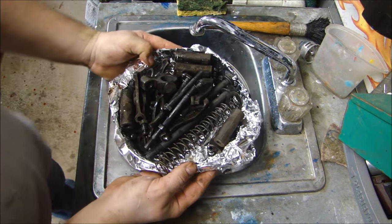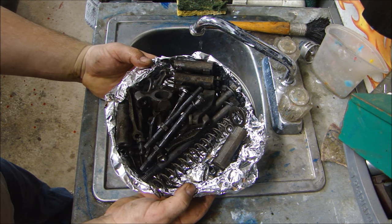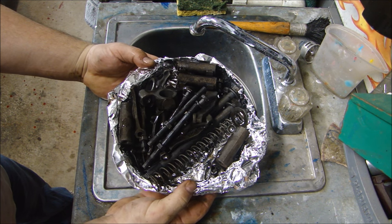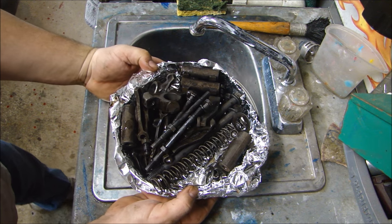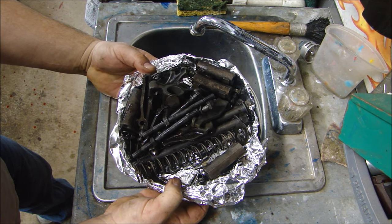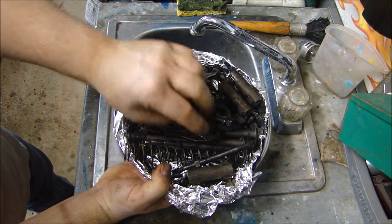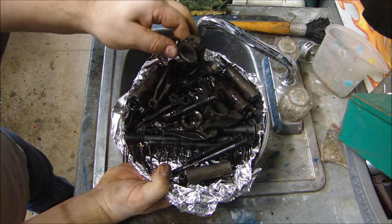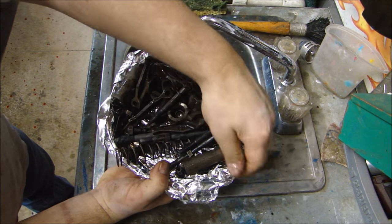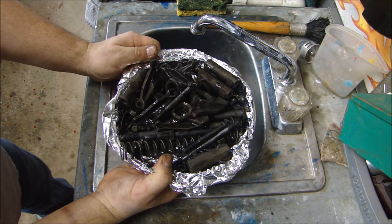Just to make sure I get every last bit, I'm going to put these in an oven and bake them at 375 degrees, leaving them in there for a few hours just to bake off that last amount of oil. Luckily I have an oven in my shop — the same oven I use for powder coating — where I can bake parts. But you can put them in your kitchen oven too — just ask your wife for permission to put car parts in the oven. I'm going to put these in the oven, and when they come out that should be a little cleaner. I'll do one last rinse and these parts will be absolutely clean.